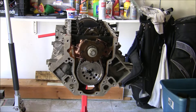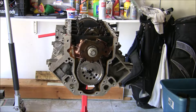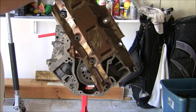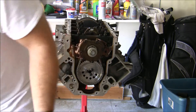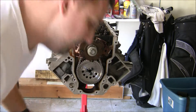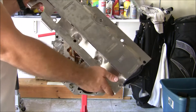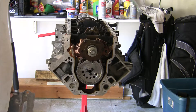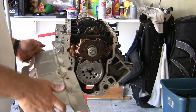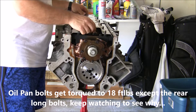Okay, this is take two — I'm really hoping to install the oil pan, windage tray, and front cover this time. Here's the windage tray — as you can see I chewed it up pretty good, so this one is getting scrapped and I did get another one. The part number is 126-111-29. Based on the oil pump design for this particular pan I'm not going to have to modify this at all. All these bolts get torqued down to 18 foot-pounds.